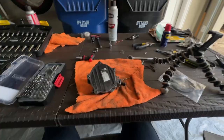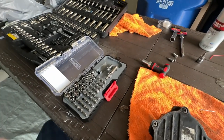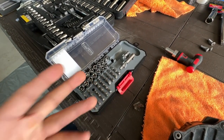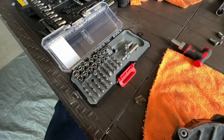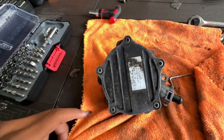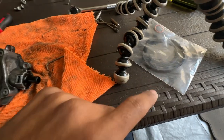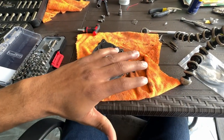It is a brand new day — bright and early at 8 o'clock. I had to go buy a torx bit set. For German cars, just go ahead and buy a full torx bit set — you're going to need all of them at some point. I went ahead and bit the bullet and got the set. I cleaned off the pump as best I could, and I can finally get a T25 into these star screws. We're going to take off this cover, replace the gasket, flip it over, replace the seals, and put it back on the car.